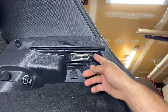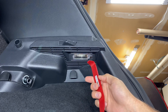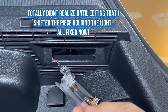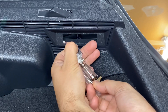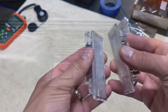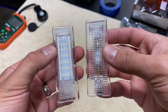Here's the light — there's a little indentation on this side, so that's where I'll try to pull it out from. I have the interior trim tool with the 90-degree end, so I'm just going to get that right in here, pop it down — it should wiggle right out. There's just a little clip you press on both sides, and there we go, it comes right out.